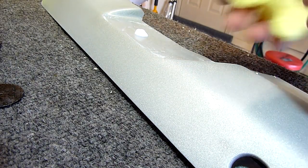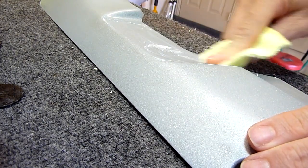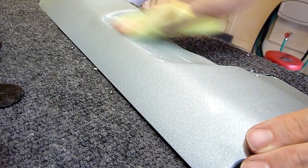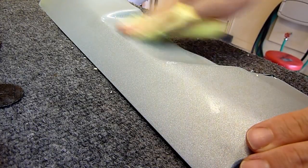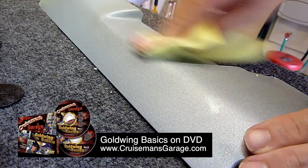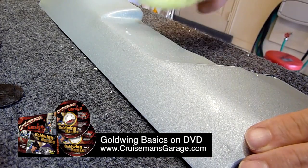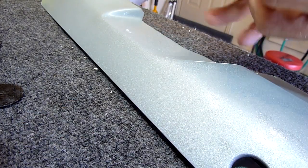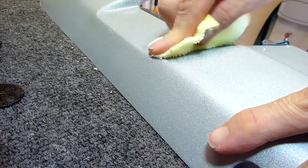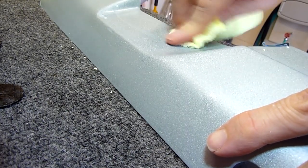So I'm going to do that now — I'm just going to try it on a little section and really rub it in and get some bite on it. The rubbing compound removes a lot of material. It has more grit and more cut to it than the polishing compound, so it'll still be a slightly dull finish after I rub it out. Then I'll come back with polishing compound and see what kind of surface we get.